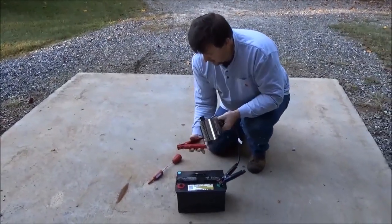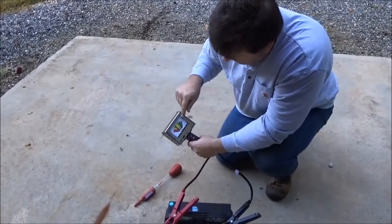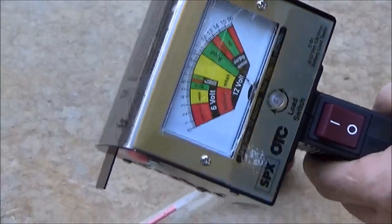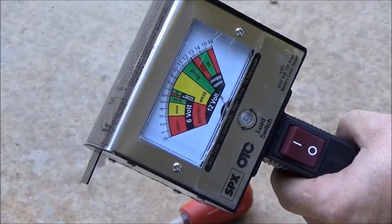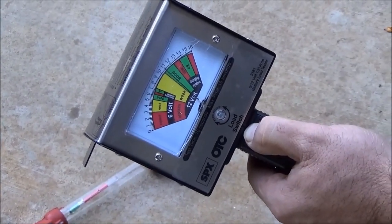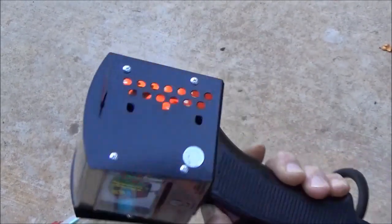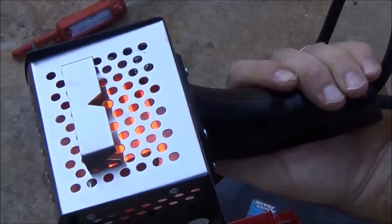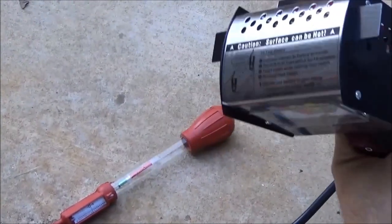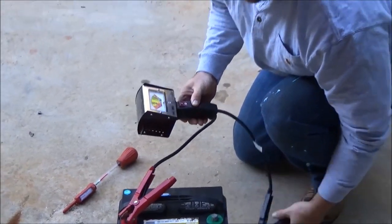On the meter, I haven't had a charger or anything on this and it's close to good — it's showing me about 12.4 to 12.5 volts. A full 12-volt battery is 12.7 to 12.8 volts. I'm going to hold the button down — it's heading towards weak, but the state of charge is also low. You can see the glow — that's what the tester is doing, just a resistive heat load, which is keeping me warm on this cool morning. This battery is testing out good for a load.